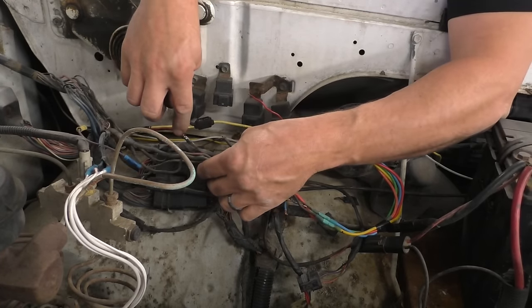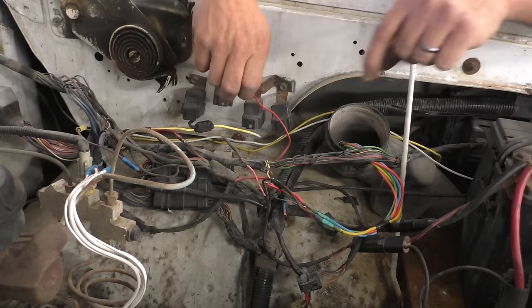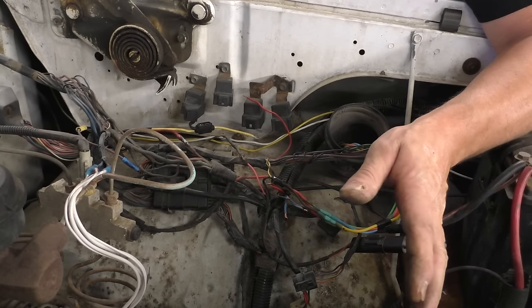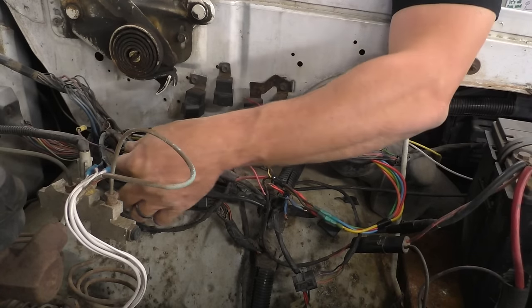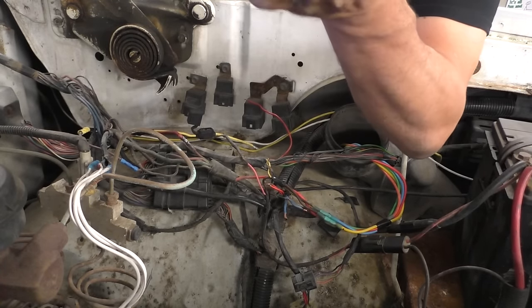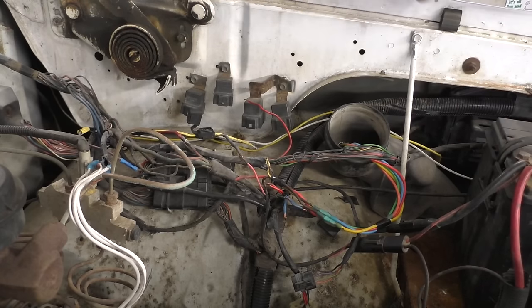So I'm gonna let that solidify before we figure out too much. I'm gonna go get us a 10 amp fuse. We're gonna stick it in here. We're gonna wire up our relay. And then hopefully the fuel pump is still broken. And then we'll figure out what's up with that. And then ultimately I'm gonna have to come back and fix some of this. We're gonna take out some of this rigging up down here. We're gonna fix this wire before it becomes a problem, the one that's all split open. Hopefully get this girl a semi-reliable truck.